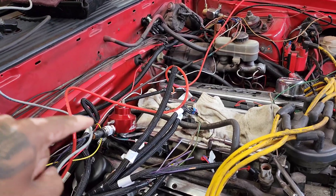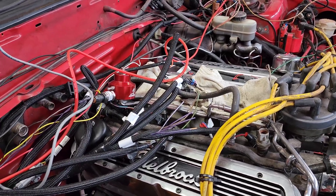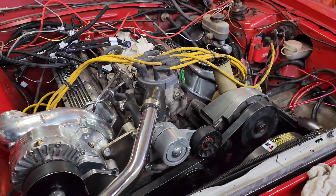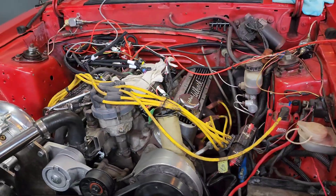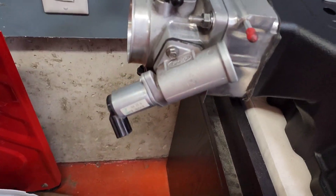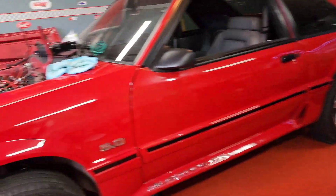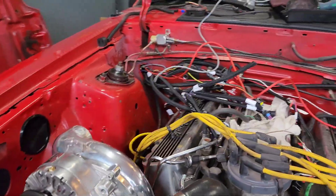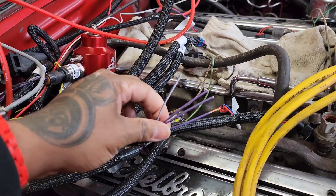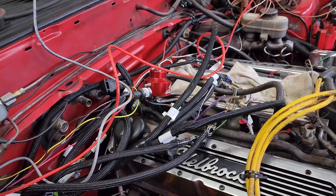You'll need to cut that as well. However, MF Customs — Danny Kilburn, I believe his name is — that is his company and he sells some adapters for it as well, which is phenomenal. A huge shoutout to him who helped me quite a bit. I'm running the original Ford IAC with its plug, and on the Holley system that's obviously not the compatible plug. So I cut the plug off and he ran me through what I needed to do to connect it so it communicates with the Holley.